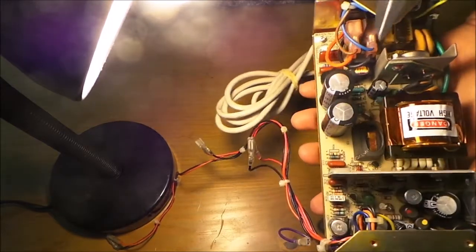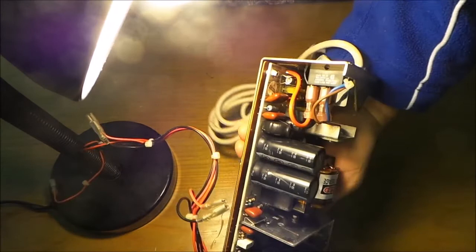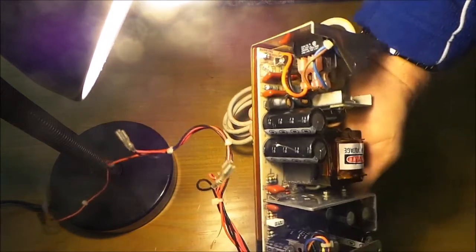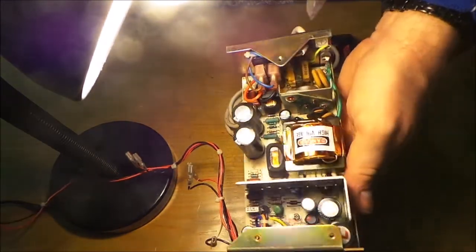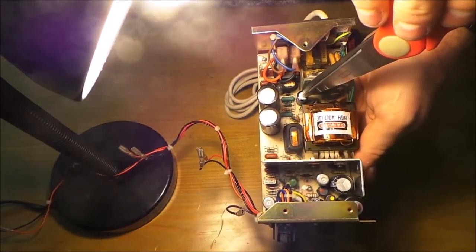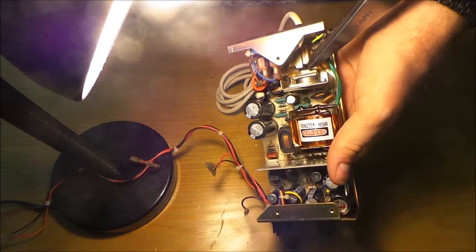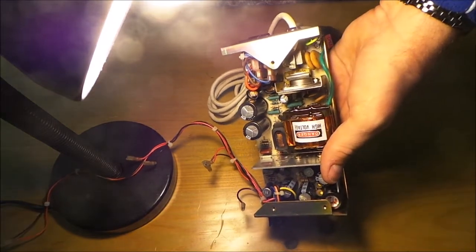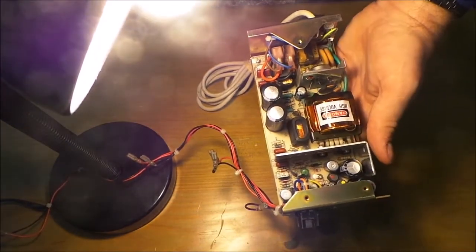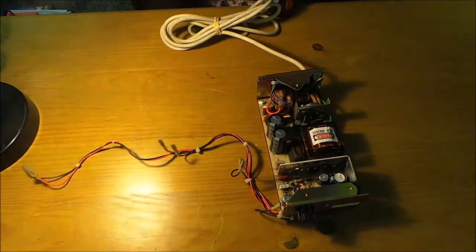The next replacement one is, right, let's do this. See if we can get it. It's there. That one there. That's the next one. And the other one, I think, is buried in the depths. No, it's that one there. That's the next one we have to replace. And they're the 3 capacitors you have to replace. So on this one, that one is broke. That one's popped there. That's the one that's popped. So what we're going to do now is dismantle this and eventually only have the power board on the table.